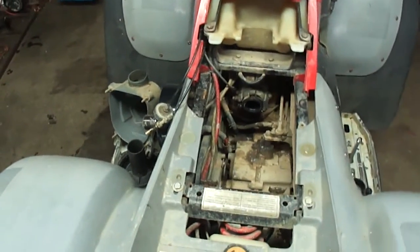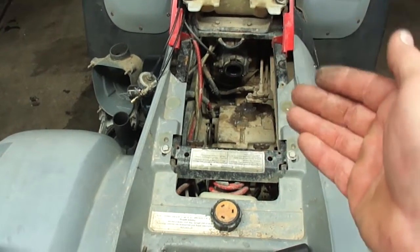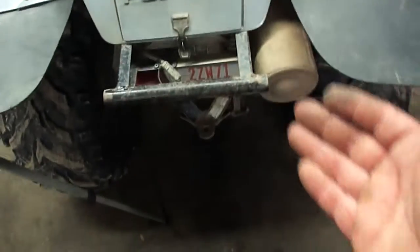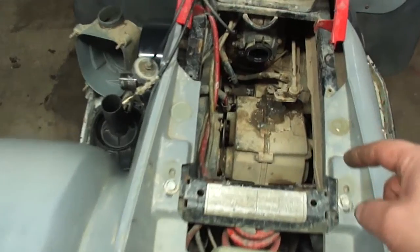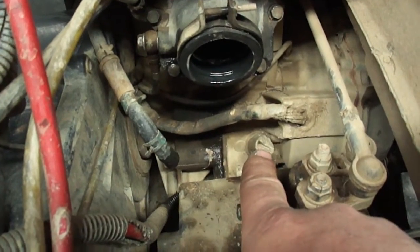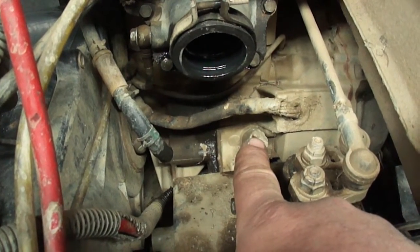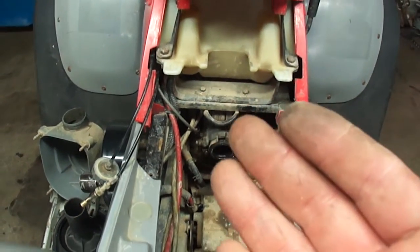The crankshaft seal on the right side of the machine is inside the balance shaft cover and there's oil in there. If that is leaking, you'll be getting excessive white smoke out of the exhaust and it won't last long. It'll suck it out of there, and then when you go to check the oil, there's a dipstick to the balance shaft. That'll be empty if it's already all burnt out. So you want to check and make sure you're not having any vacuum leaks.